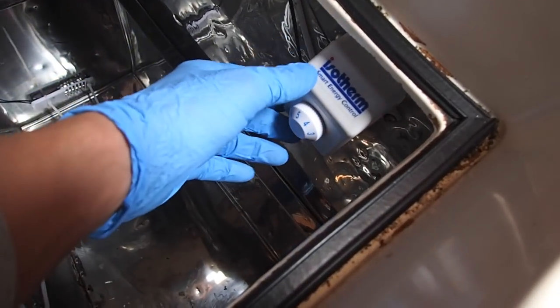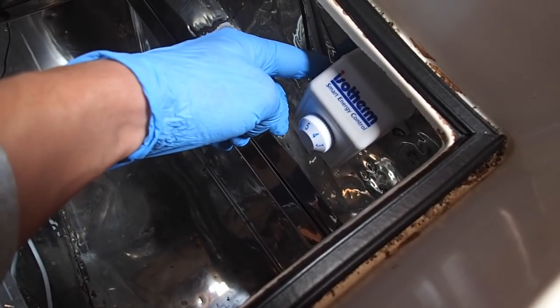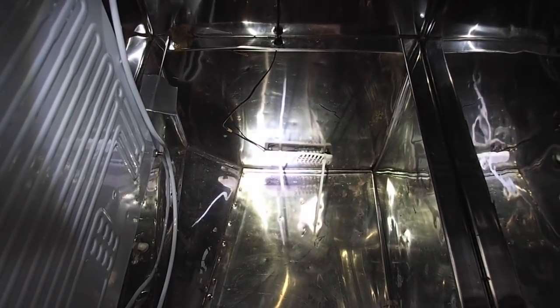Here's our installation so far. Over here we've got the temperature switch, and we've got the control wire — the white wire — that goes back to the energy saver unit on the compressor, the blue unit. And then this black wire, again, is our temperature sensor. The temperature sensor goes down — right back down there, that white thing is the temperature sensor. Probably not the best install that's ever happened, but I do have some life caulk on the back of it and it's going to stay in there. We also have a shelf that rests up against it. I'm going to take off the tails of those zip ties, and then I'm going to go into the other cabinet and start working on the dip switches, and then we will hook up the unit and see if it works.